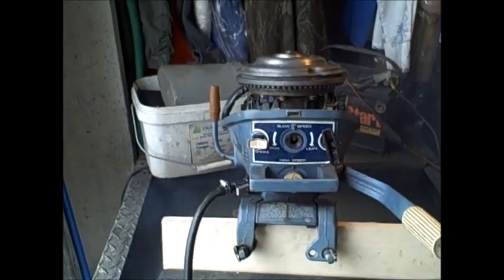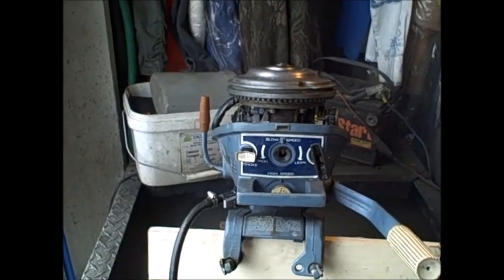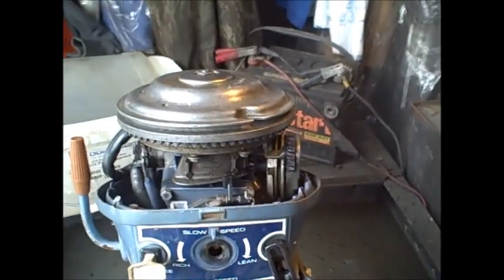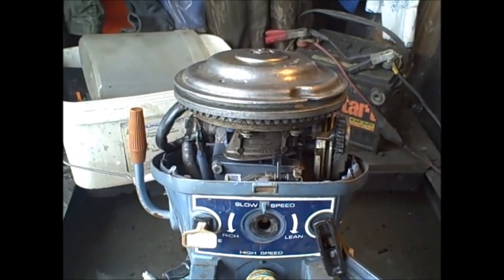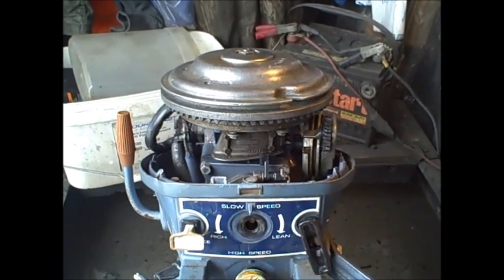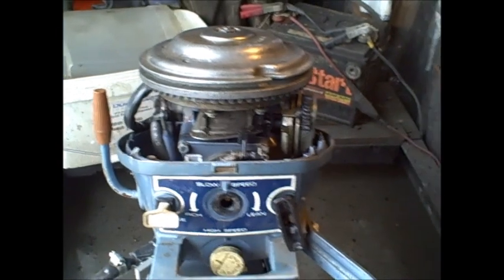So there you go. The Nova chip seems like it'll do as good as the Atom chip. There are little differences about the spark plug gap and all. But she starts, she runs. That starter could use a little work — the spring's weak, it's not wound right, the rope's about to break. You've got to remember, this was a barn find cobweb special. If you remember in one of my other videos I put Atom chips under the flywheel — well, the Nova chips are a little fatter, so you have to find a place to mount them. But other than that it's pretty straightforward. Thanks for watching.